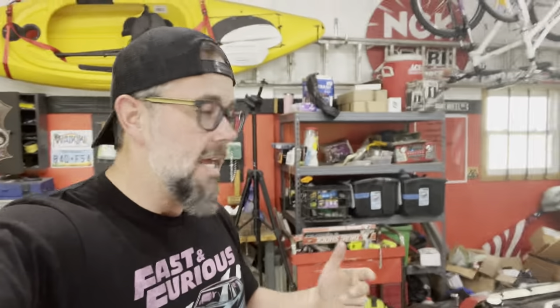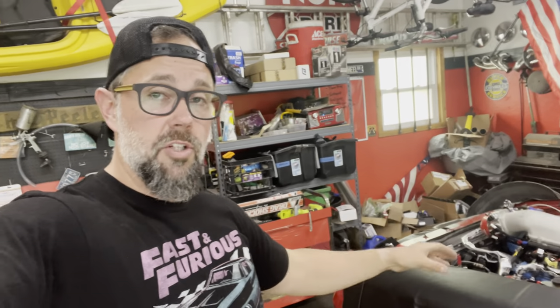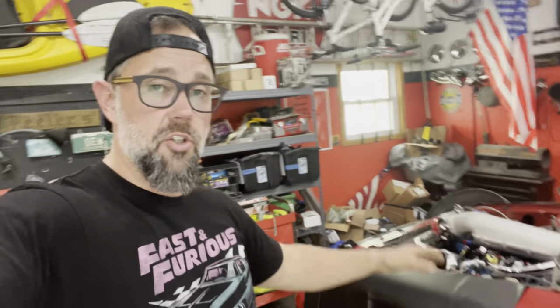So I just tried some cranking. Now that we got gas in the car it still didn't help. But one thing I noticed: if I put my foot to the floor — which should shut off the fuel injectors — then we started to get some popping and more action going on. So I'm wondering if something's up with the injector settings. In the computer I have them set as DECA 80 pounders, which from what I've read online is what a lot of people do with these aftermarket DECA 80 pounders. Maybe there's something off there. I'm going to try to do some research and then probably do a compression test just to make sure we've got good compression on both banks — rule that out. Danny was also telling me to try to verify the timing again.